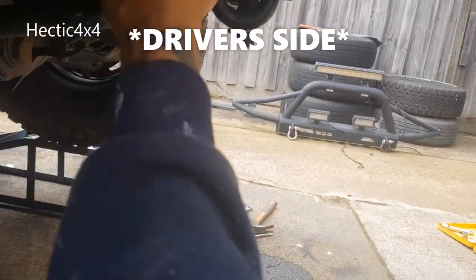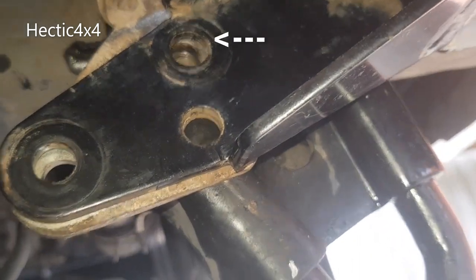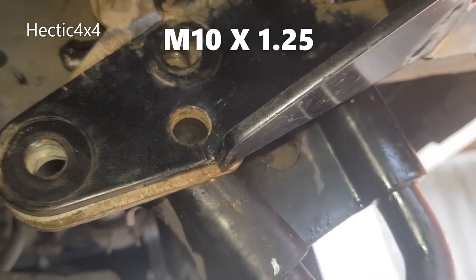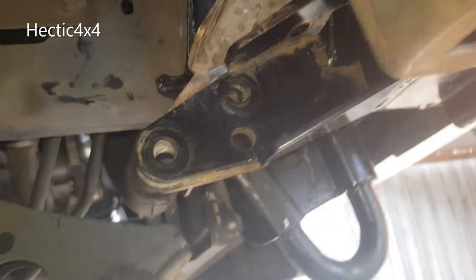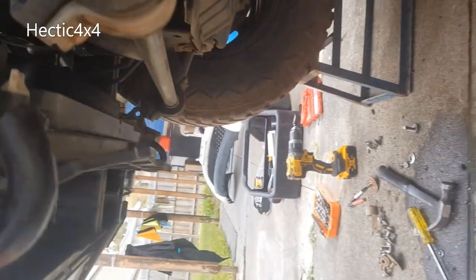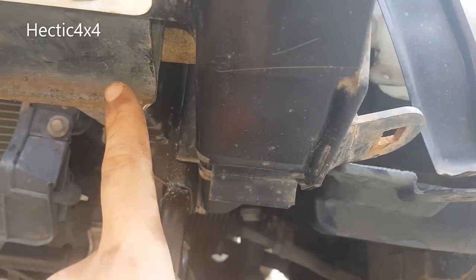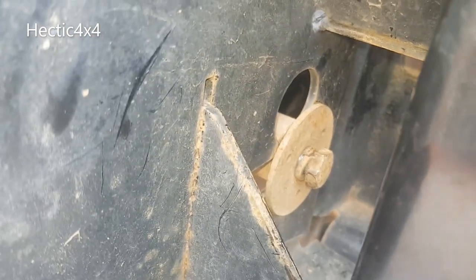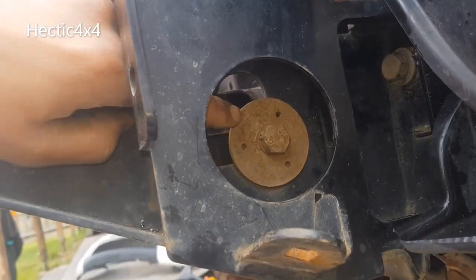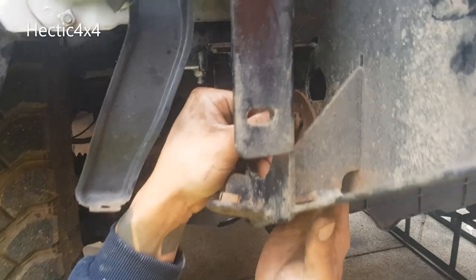On the left side on the chassis there's a top screw hole - it's actually got the thread there. The bolt you need is an M10 by 1.25 thread, which they don't sell at Bunnings - got mine from Super Cheap. On the passenger side, you just put a bolt straight through - any bolt. We've just put in that washer there. That's the big washer, that's the chassis, that's the bull bar bracket. You sit it up in that hole, leave the bracket off the chassis and it drops in, then you put the bolt in and that threads into the chassis.